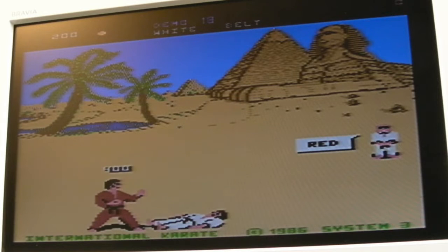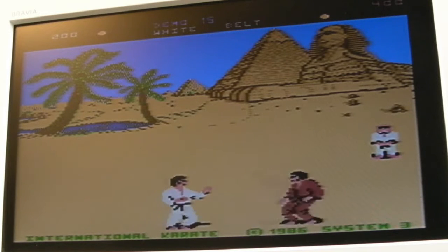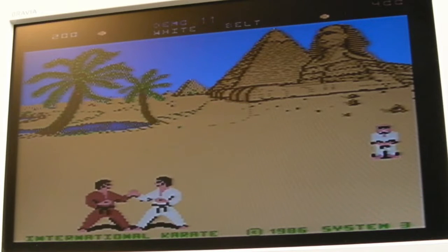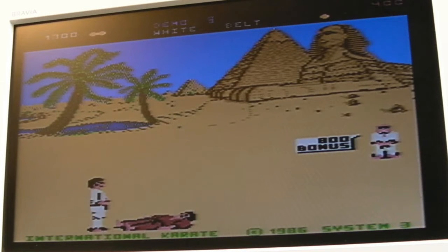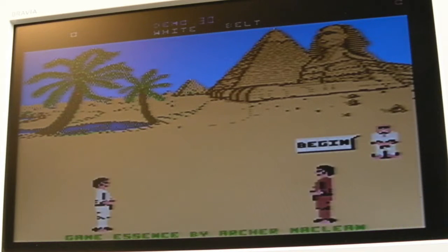And that's bound to happen, because if you get some variation on your clocks there, just from a bit of temperature change, and it's temperature change that's quite quick, this is the thing, you wouldn't notice it so much, and the system would warm evenly. What I mean by that is the board's warming up in certain ways, and at no one point under normal operation do the crystals get hot or ANTIC just get hot on its own. And that's where you're going to see things like that. In theory, if you heat it too much, you could kill something. But we're just using 100 degrees here for maybe 10 or 20 seconds just to get it warm.